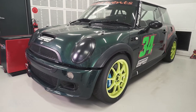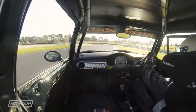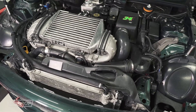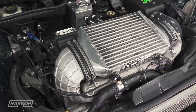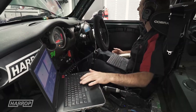We also evaluated a dedicated club race car that had a stock M45 supercharger, 15% overdriven, measuring 16.8 PSI of boost, with a ported head, cam upgrade, forged rotating internals, larger top mount intercooler, headers and a full exhaust. This combination achieved 181 horsepower at 6400 RPM.